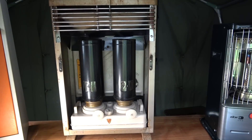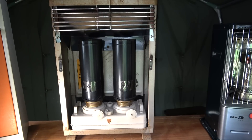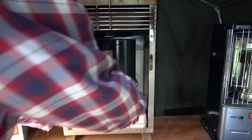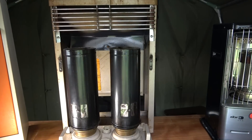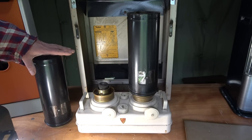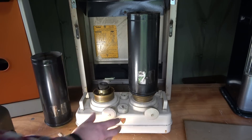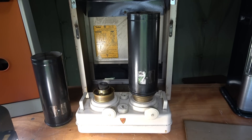Now moving on to the Valor - really old school, English company, fantastic. They last for years. I won't even guess how old this thing is, but she works like an absolute charm. I chose this particular model because it's got two chimneys - twice the amount of heat. This will seriously heat up a room super fast. To get access, there are two handles on there. Pretty much the same as the Aladdin - when cold you just turn and lift off. The wick is just around inside there and you can control it by moving it up and down to adjust the flame.